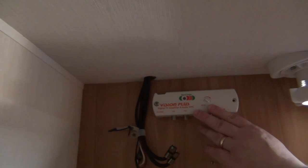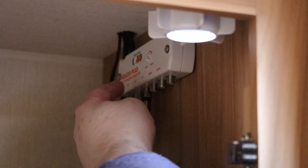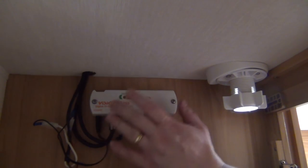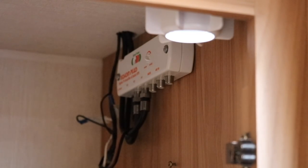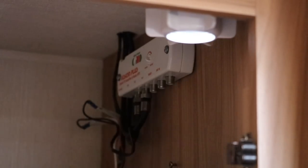At this point I really struggled to fit the amplifier to the caravan. I reused one of the old mounting holes and had to make a new one, but once fitted I realised the F-type plugs couldn't quite get enough reach to screw into the amplifier. So I needed to remove a P-clip, remove the amplifier, plug the plugs back on, and refit the whole unit. What I ended up doing is taking the amplifier off, screwing the F-type connections on, and then putting it back up — simply because of the location. I'm glad I did it without the antenna in place. Now I'll tidy up these cables later on.